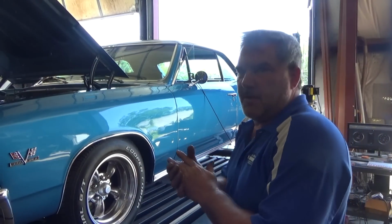Alright, well, I just upped my jets from the 85s I had in it to 87s. We're going to make the pull, see what it looks like. I think it's going to bring my graph down as a whole. And we'll see where we go from there. It's all trial and error. Take it the way you like it.